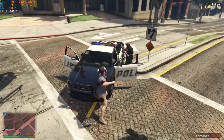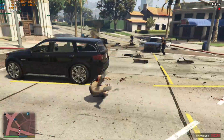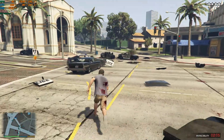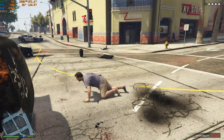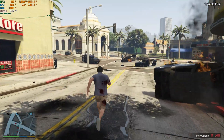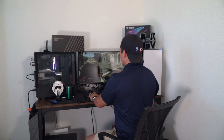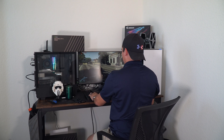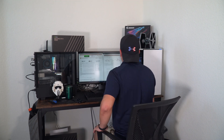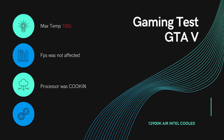I'm only using at most 20% of the CPU and I'm at 100 degrees — 118 watts of power. But my FPS has stayed at 144, so we're good. The CPU is heating up real good. I did put cheat codes in so that everything explodes, to make the graphics card and CPU work. I've already hit the max temp. My FPS is not really affected, which is cool, but still I don't recommend it because if you're letting your processor hover in the 90s to 100 degrees, you're just going to ruin your processor over time. Max temp — almost like the first seven cores hit 100 degrees. Definitely not ideal. That was like a nine-year-old game and the processor was cooking.